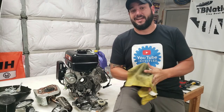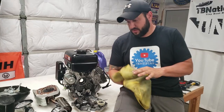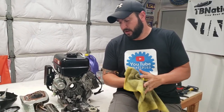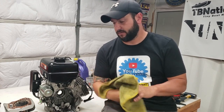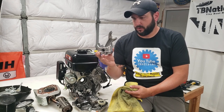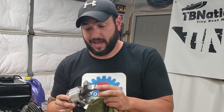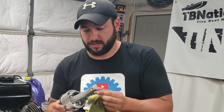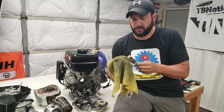I'm curious to hear what all the YouTube certified experts on small engines have to say about this one — let me know down in the comments what you think happened and where we should go from here. It could have been the factory forgetting to tighten up the rod bolts all the way, or it could have been that I was revving this thing at like 6,000 RPMs with the governor still in it. I've never had a problem with Predator rods before, but I've never spun one over 5,000 RPMs. So if I'm going to continue spinning engines up to the moon in RPMs, billet rods at minimum is going to be necessary.